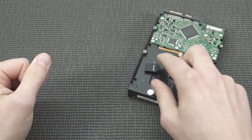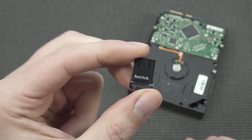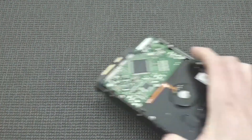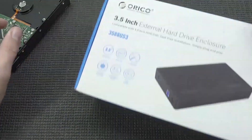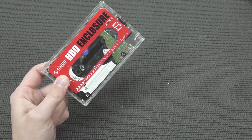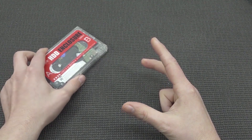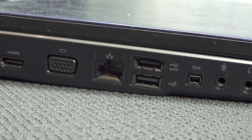Then there's the thumb drive option, but the downside is this laptop only has USB 2.0, so a USB 3.0 stick won't reach its full potential and loading times will be significantly longer - not something I recommend. You can get yourself a bigger external hard drive, but again the same problem: we can't use 3.0 speed, so we'll get lower speed through USB. Not convenient. Even an enclosure with a hard drive has the same issue - no fast speed.